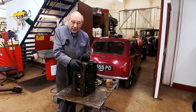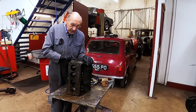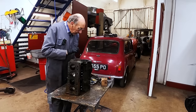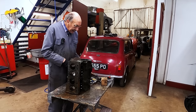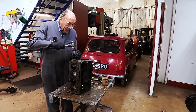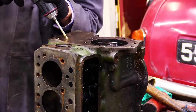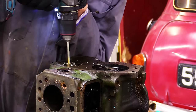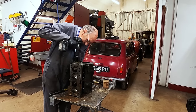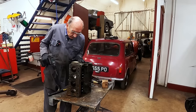And so, really, we've got to take the main oil gallery plugs out so that we can look inside there. And what it is, it's just a brass plug that somebody on the production line just hammers in, done. So obviously there's no easy way to get it out. So what we do is we set the punch centre like that, get the drill, drill a hole through it,